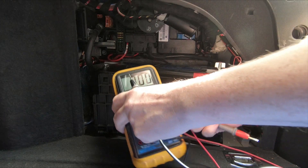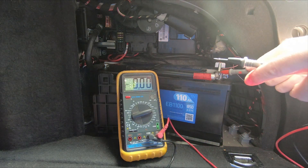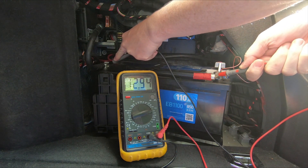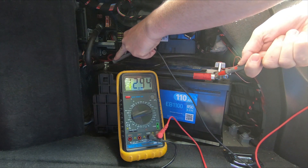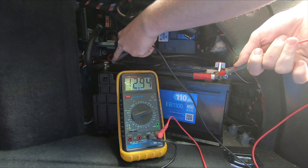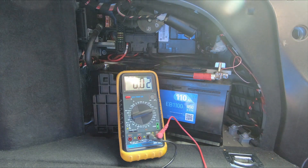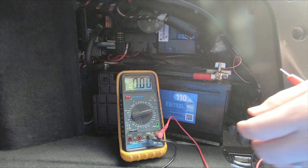I'm just going to check the voltage on the battery at the moment. I have just driven the car so I expect a decent charge — 12.94 volts. When it's charging it probably goes up to 13.5 to near 14 volts, but when the car's not running, 12.94 is a good voltage. However, I know from last week that if I switch the systems on without running the car for very long it will run down quickly, so I am going to change it.